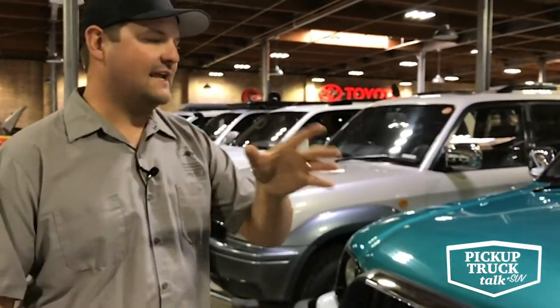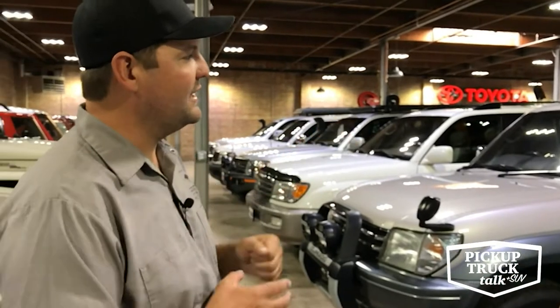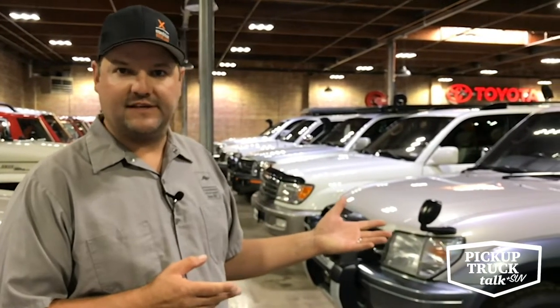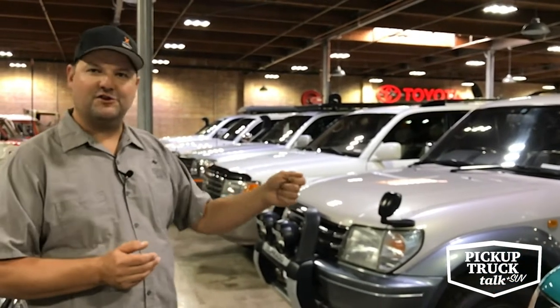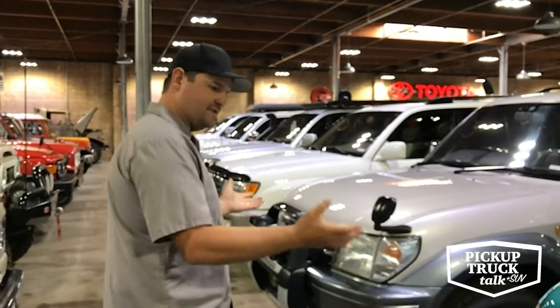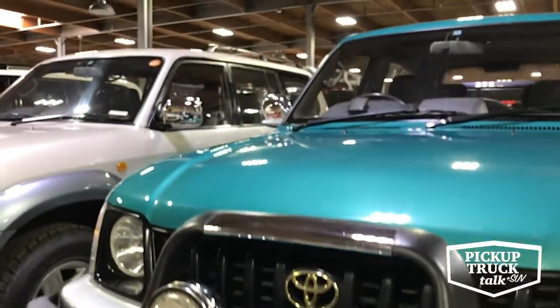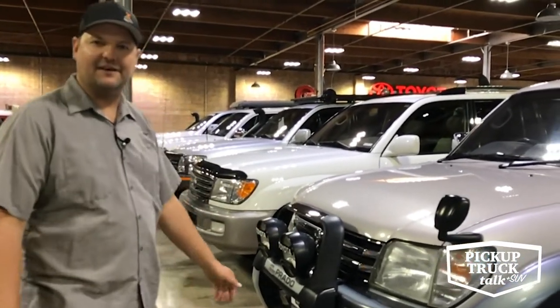Then we jump back to Prados — that was the 80 series — and now you have the 90 series. The 90 is available as a 90 and a 95: the 90 is a two-door, the 95 is a four-door. These are both VZJ models with a 5VZ-FE — the same 3.4-liter that a Tacoma would have had from '96 to '04 or a '96 to '02 4Runner. A super well-known V6 Toyota motor, but in the Prado lineup. These would be parallel to a US-spec 4Runner from the same years. They did really start labeling as Land Cruiser Prado in the later years. Both are JDM market ones, so you see the fender-mounted mirrors and factory Toyota fog lights.